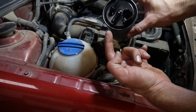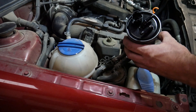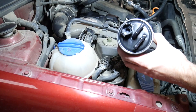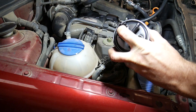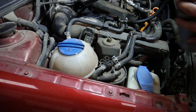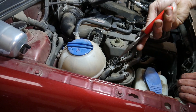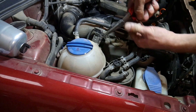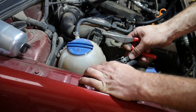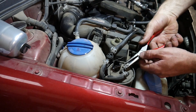Now for the filter there's an inlet, an outlet, and a return line. Be careful — this had rubber caps on two of the lines, but it's hard to see there's also a rubber cap down inside the return port that we need to pop out. When servicing this there's a plastic fitting that clips down into the fuel filter on the return side. You just pull this metal snap ring out, don't unhook the lines — just lift straight up on that fitting. Then we remove the hose clamps and the lines from the other two ports.